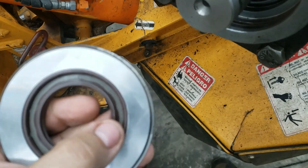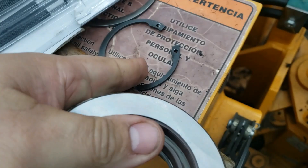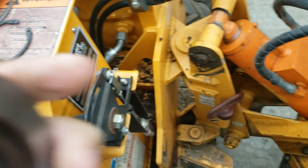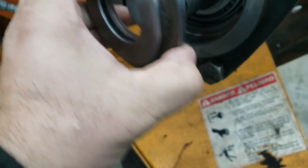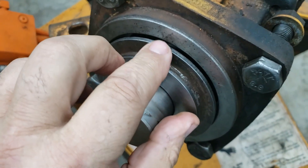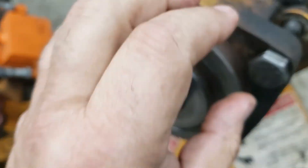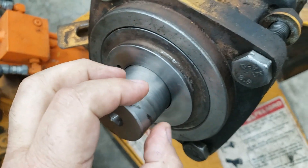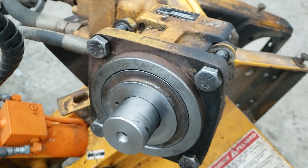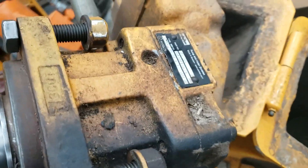You'll have a large socket and you tap it down to where it's flat. Put that seat clip back in — it goes around here. Then put the round gasket back, place it back over your shaft, put it down, and the large C-clip goes back in. Then you're just going to reverse all the other videos I showed you about how to get that hub and wheel back on — same thing just in reverse. You can get the O-ring basically anywhere, but get that oil seal from Bandit.